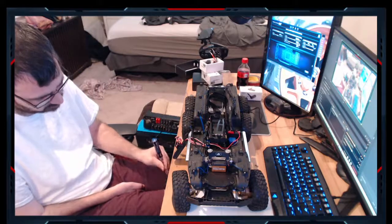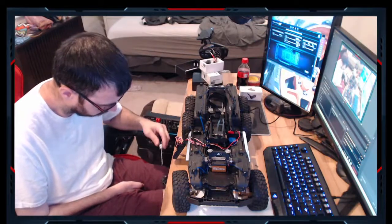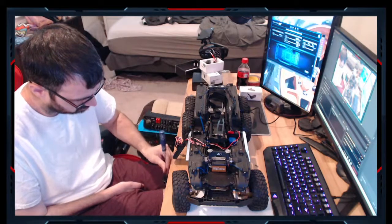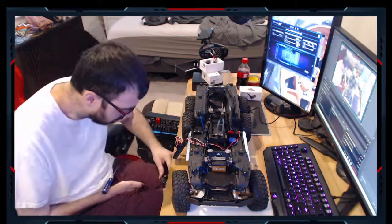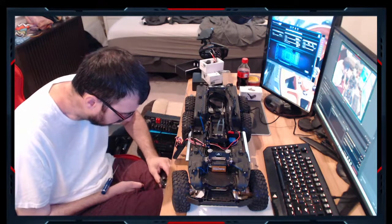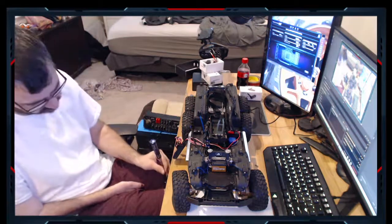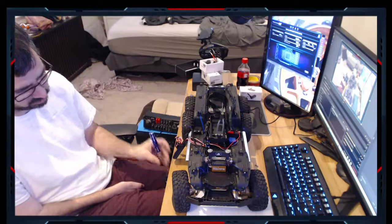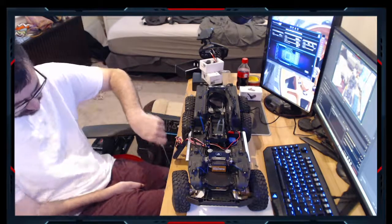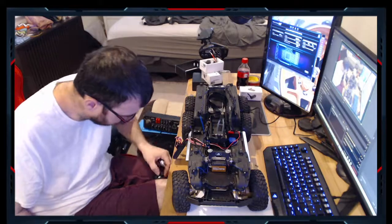Alright. So if we need to move the mesh, we're gonna have to do it from the other side. Pop one. I think we're going to be stuck with this where it's at. I don't think we can really move it. Alright, we're going to do a full test fit. Tighten everything down. Double check the mesh because, because of the size of this pinion, I can't really move it. It's not giving me a whole lot of options to move.